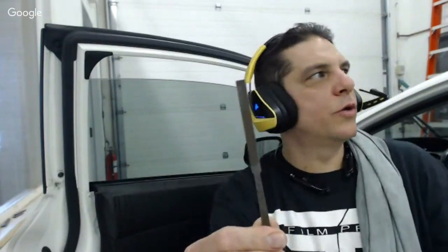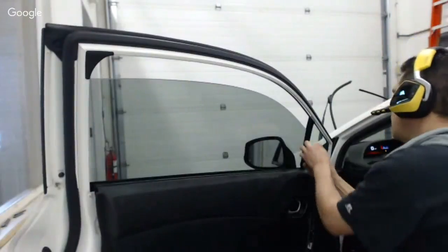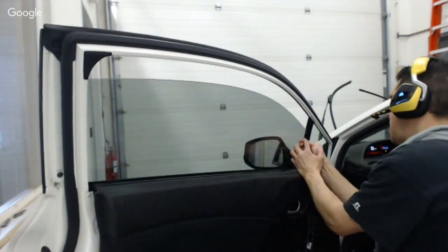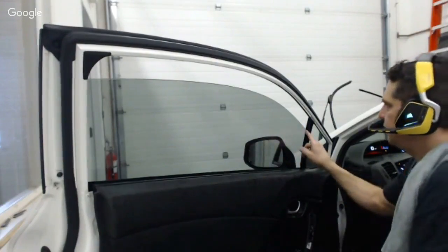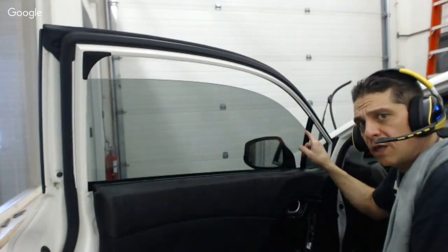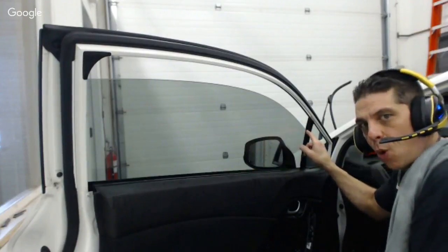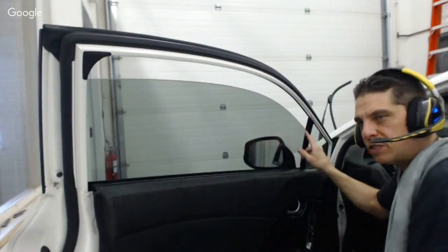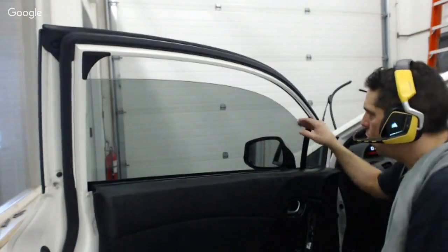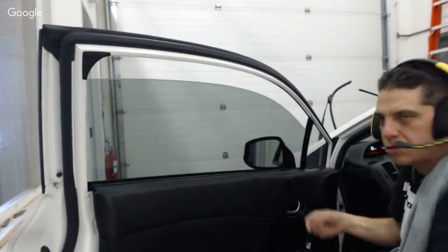Then I got this other little jeweler squeegee. Awesome. This one I actually get in the corners. So the two work together. So normally what I'll do is I'll get in this edge, and then I know I have my piece started, because if I don't file what's in this edge very carefully, it'll end up pulling. It'll end up where I rip the film. So you've got to get this corner started just right and get it so that it's being filed outside. You want to visibly see the edge of the film kind of roll over the window, and usually when I'm filing, it'll go to the outside and it'll be a big long string when I'm done.